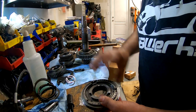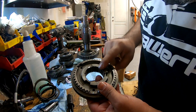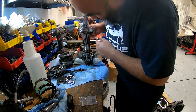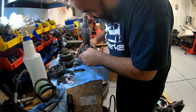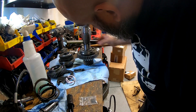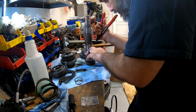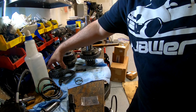Now we can put this hub into the shaft - numbers down. On this one you do need to line up the cuts with the holes in the input shaft because this one kept the synchro - it's really important that you line them up, just like in the last video I did. The best way to find alignment is use the hole on top - you want to be just a little bit over, then move your synchro until it clicks in, keep moving it until the other one goes in, and boom - that's it, all the way in. Now put the clip - the biggest snap ring - and push it in. Going in is a lot easier than going out.